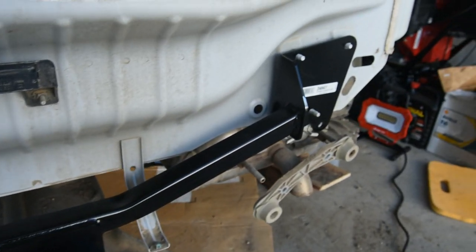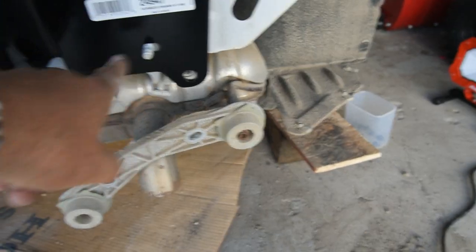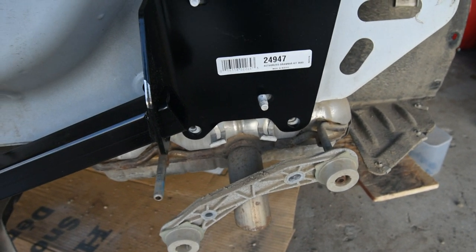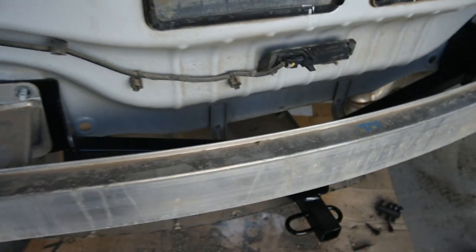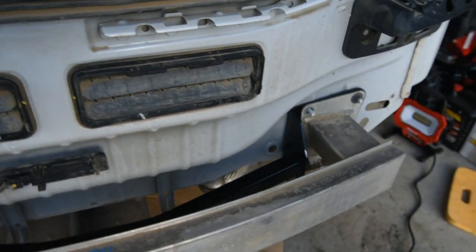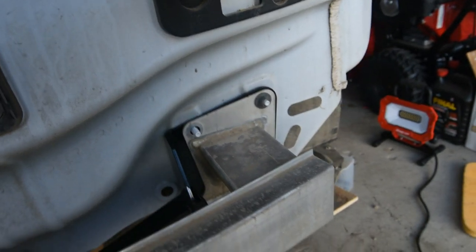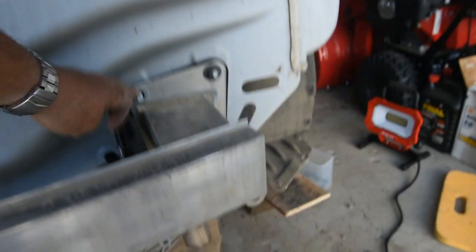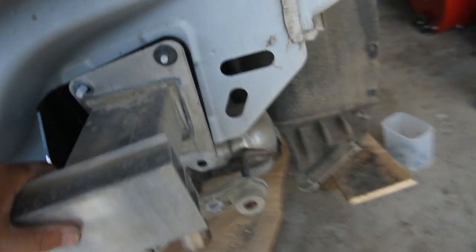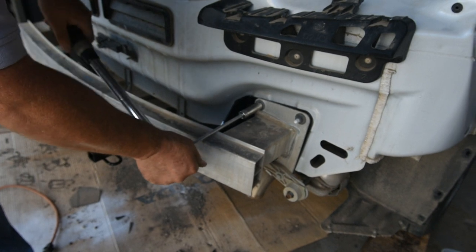After you take off the bumper, this is a Draw-Tite hitch — this is the second one I've ordered. My Chevy Bolt was so much easier — didn't have to take off the bumper or anything. Anyway, you stick them in there and then you put your bumper back on. Remember we've got our hanger here, so set these bolts straight. We just set the bumper back on and finger-tighten these. It's very light — probably weighs five or six pounds. It's aluminum. We're going to finish tightening the bolts, torquing them down. The instructions give you the torque specs. We're tightening our two hanger bolts down to 38 foot-pounds torque.